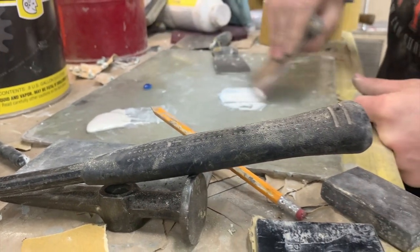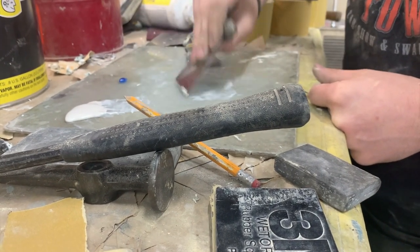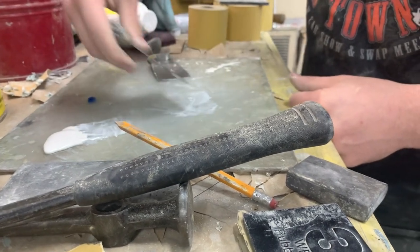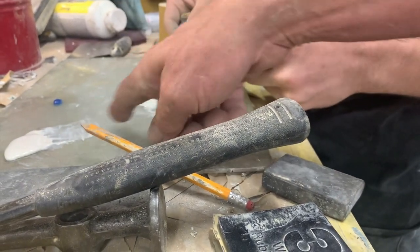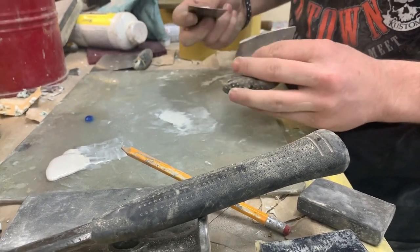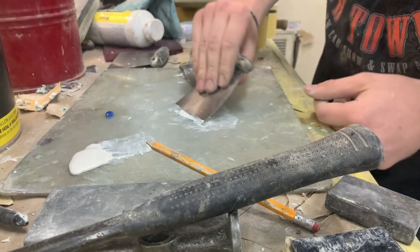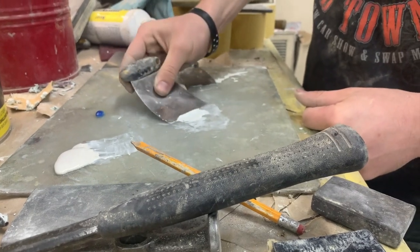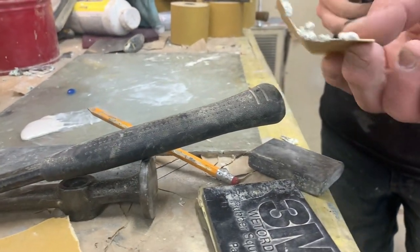The more hardener you put into it, the faster it's going to cure. So it doesn't actually dry, it's a chemical process. You see how there's a very slight color difference? It's just a little gray now. And this will give about a minute to 2 minutes' worth of working time. So you just mix a tiny bit at a time. We only want to mix what we think we're going to use in the next minute, because this is our leftovers.